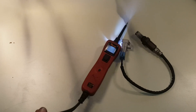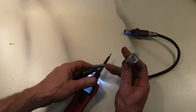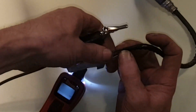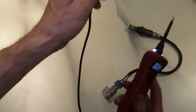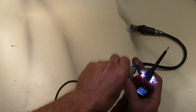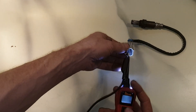I've got my power probe here — I have a link in the video description below under 'the one tool every mechanic needs.' These things are cool; basically we can check for continuity and we can apply power to see if it's actually working. So I'm going to go to the two black leads here. It doesn't matter which side you put the power or ground lead on, but first we're going to check for continuity. You can see when I touch the ground part of the power probe to the tip, that means we have continuity. And this one is testing good as far as continuity goes.